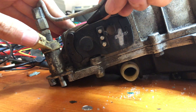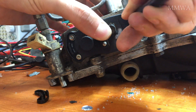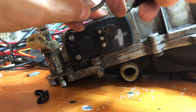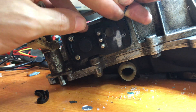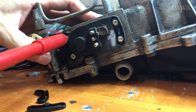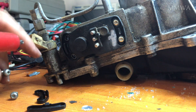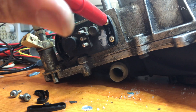The covers just keep popping back in, but you get it eventually. It can be even harder when this is on the car, particularly on some V8s where this is buried right in the middle. On this six-cylinder it's not too bad — it's pointing towards the front of the car and you have reasonable access when the air filter is off. Once the two black plastic covers are off, it's just a case of removing these four screws — they're called Torx head. I just have a security screwdriver set that has this in it, so I didn't have to buy anything to access this.